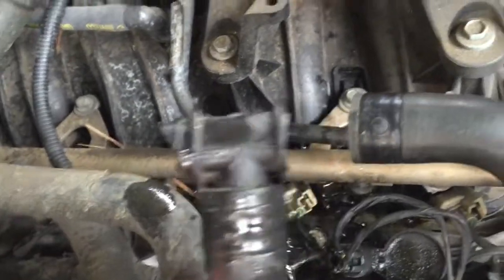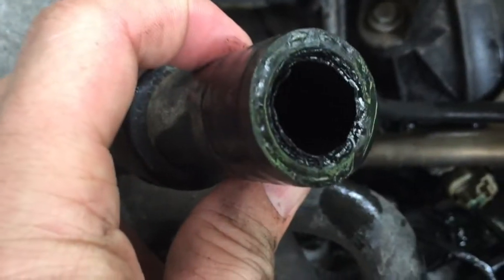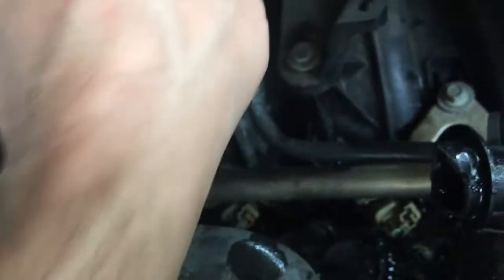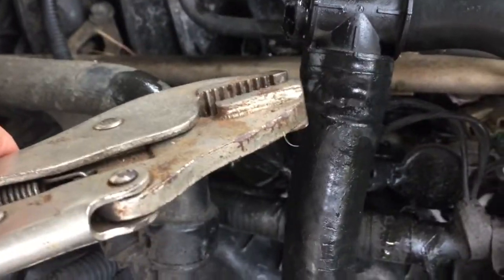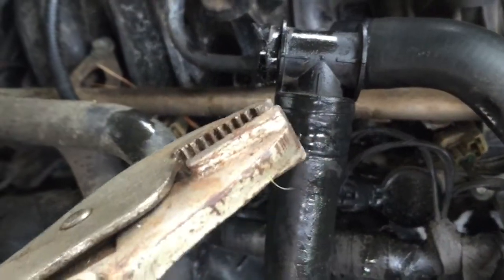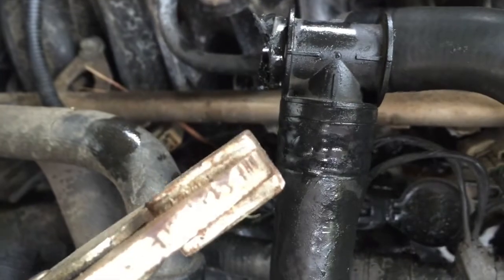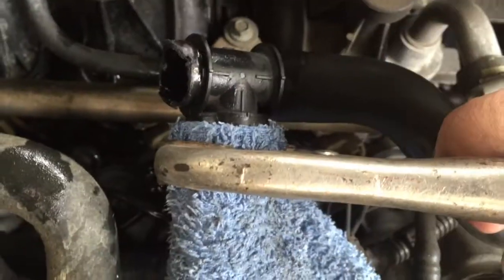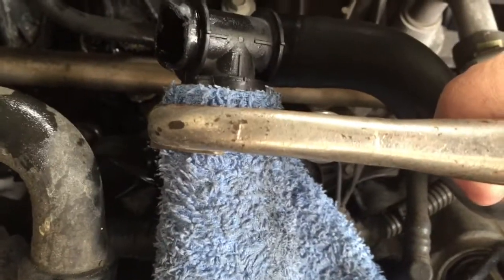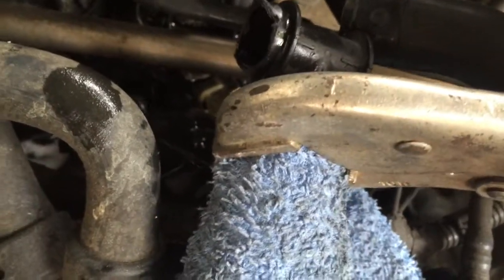This piece of plastic is so brittle — you can see it broke off on both ends, which left a little piece down inside the tube. So we're going to take a pair of pliers and crush this little plastic piece inside here. We'll wrap it in a little bit of towel and crimp down on it to crush it enough to get the whole plastic out. You want to bend the hose downward so you don't get any particle fragments falling down your hose line.